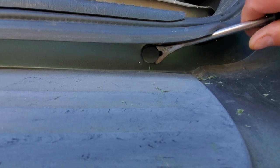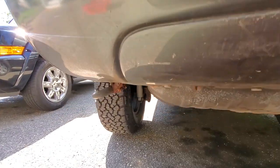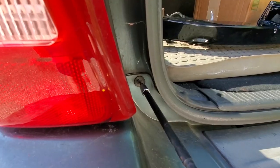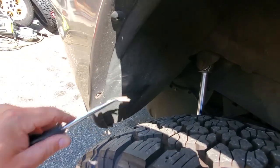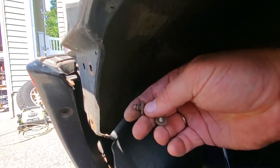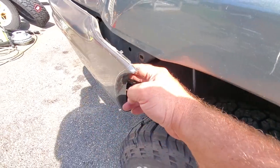To start, we're going to take off this bumper. Right in here under this little piece of weather stripping, pop out these fasteners — got more down here. We also have a T15 Torx right in here. Over in the wheel well, these are plastic rivets so they're gonna have to break off. Once you've broken off all three rivets on both sides, pull out the wheel well liner — that gives you room to reach a 10 millimeter fastener. Of course, if your Jeep is rusty and corroded like mine, the bolt will snap off.